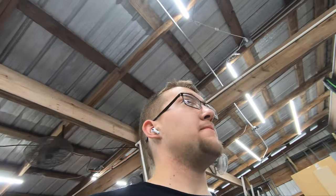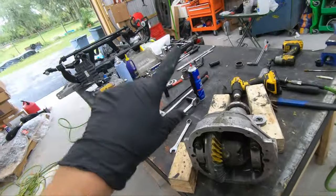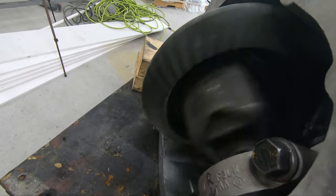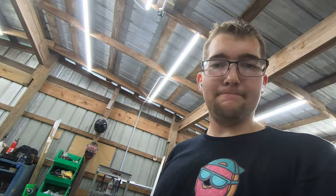It's the next day, almost night time. I've been fighting this all day but I finally got it — nice crescent-shaped contact pattern. It's a little high on the heel side but I don't feel like messing with it anymore. I'm ready to get this thing together and mounted in the suspension so I can be done with it. I want to get it in the car so the car is a roller. Going to clean this up, remove the bolts — everything looks great. RTV time.